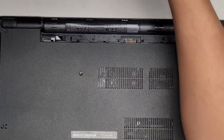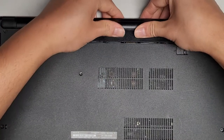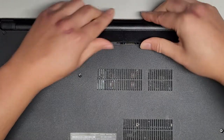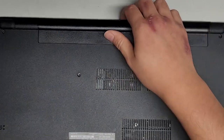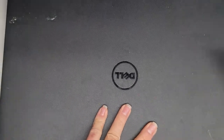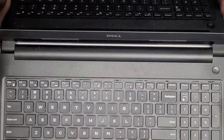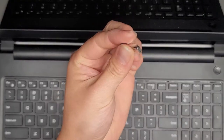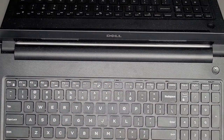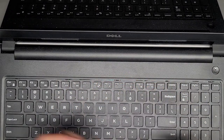We're going to close this up and put the battery back in. The battery goes in backside first — swing it downward and push it down into place, and it clicks. Flip this back over and let's go ahead and power this thing back up. We're going to install Windows 10. We've got a bootable USB — if you need to know how to create a bootable Windows 10 USB, just let me know and I'll send a link. You can create it from Microsoft for free, but you do need a USB, I think at least 16 gigs.